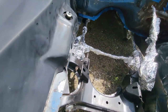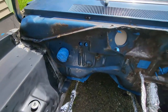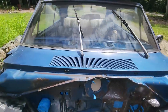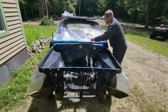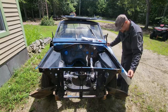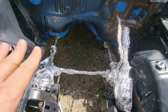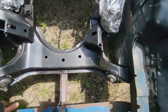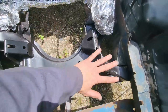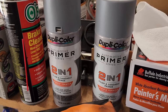I'm using aluminum foil to tape off the majority of the things I don't want paint on, and masking tape with some back-masking for the other things. I just need to get some masking up here so I can go up over the window and hood. I'll drop a chunk of plastic down along the side, bring it up the middle over the K-member, and probably back-mask here to connect so I don't get any overspray. I've never messed up an engine bay before, so we'll see.